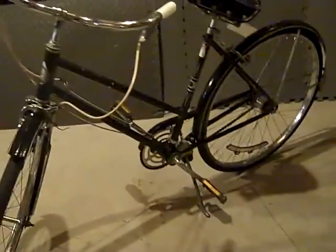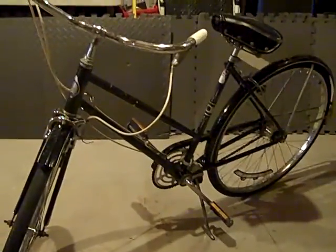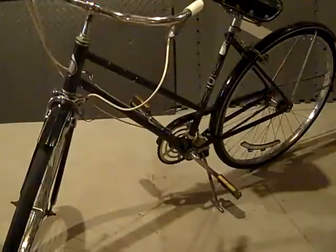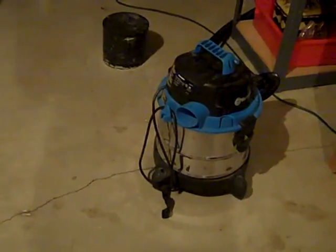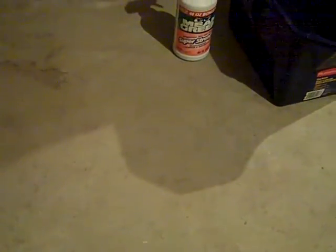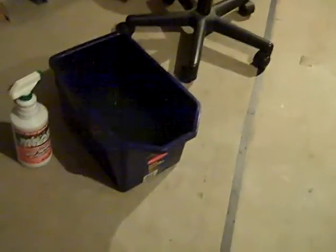Let's talk a little about bike prep. This bike wasn't in bad shape but it had been sitting in a garage for a long time. It had a lot of spider webs, so I used a shop vac with the crevice tool to suck up everything I could find. Then I gave it a good wash down with Mean Green cleaner and a sponge, being careful not to get the chain or anything wet.